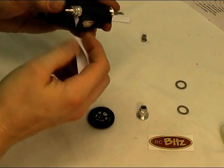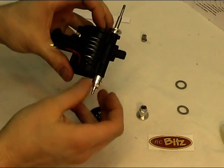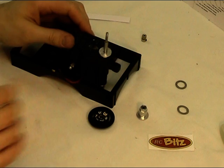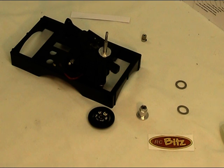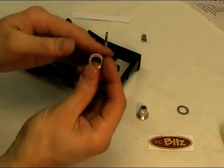And then you can just remove the piece of paper and you'll find there'll be very little play in, but the shaft won't be binding. Okay, let's pop that on our stand. You'll notice that we've not put the old cover back on, and that's really because the top plate won't fit with the ball diff. Now we just install the first washer.